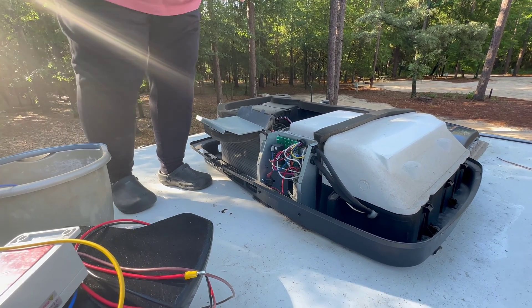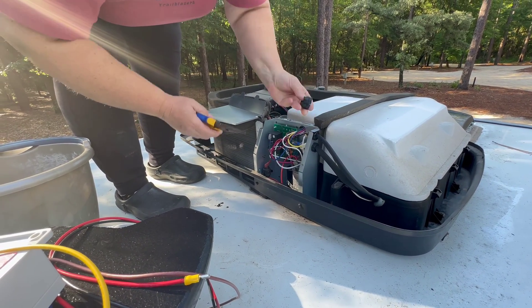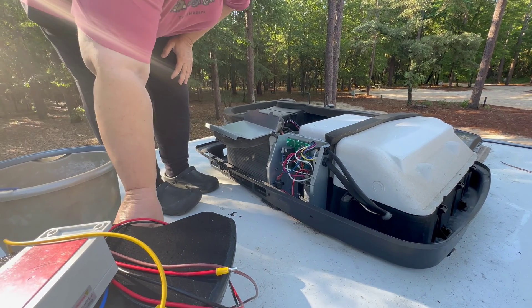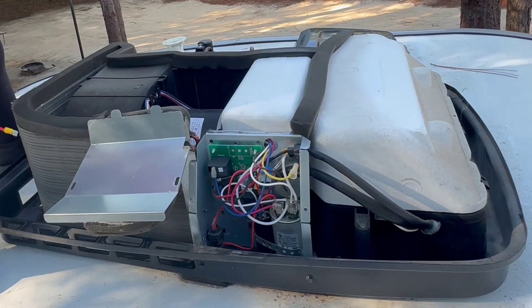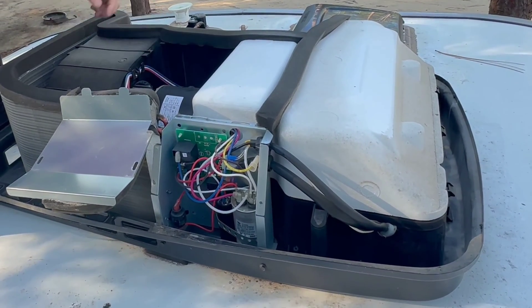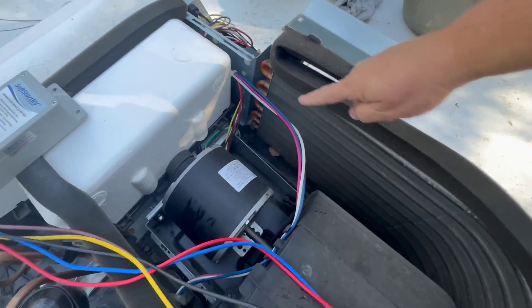This is where the predominance of the wiring is going to occur. You have to pull out the little strain relief — and as I said, the soft start gives you a new one. There's a goop covering the hole where the wires come through; that's called butyl tape, and it's just like putty, so you can easily pull it back and push your wires through. We're going to install the soft start on the outside and run the wires down through this hole where the putty is.